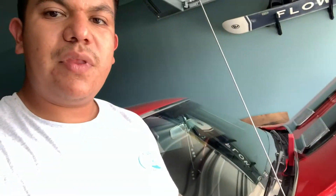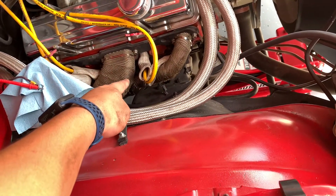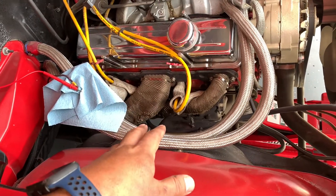So basically what I did was last night — went and got the Chevelle aligned, and while I was there it tested voltage at the starter when it wasn't starting. Sure enough, we're getting six volts at the signal side of the starter where the ignition wire goes in. Because of that, I realized there's a voltage drop and it's not enough voltage to engage the starter.